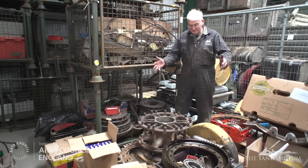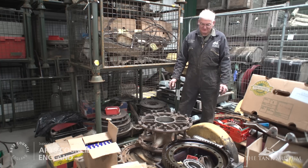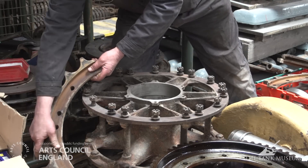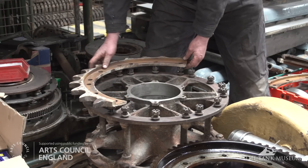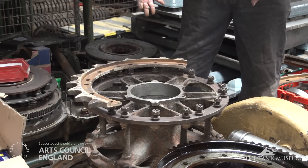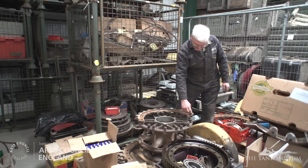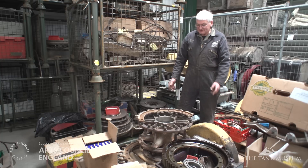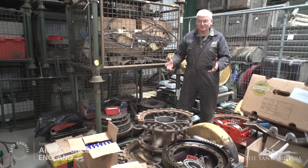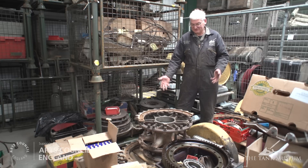Here we have a pallet containing one of the final drive assemblies with the drive sprocket and gearing. One of the things you learn during restoration projects is that fitters sometimes make modifications which quite often then get incorporated into production vehicles. We discovered that the sprocket rings are actually cut in half — we think this originally started as a fitter modification, cut with the gas axe, to fit onto the drive sprocket. However, with reference to the vehicle's spare parts list, they are later supplied in two halves. There's a practical reason: it makes it much easier to change the drive sprockets, which are wear parts and do wear considerably, making it an easy quick fix.